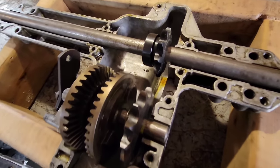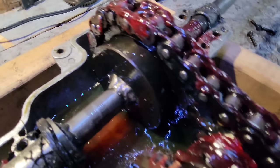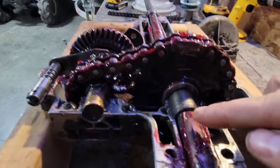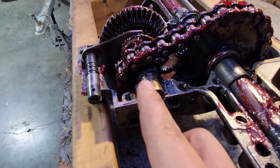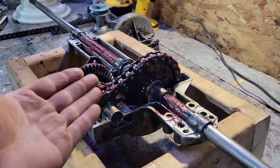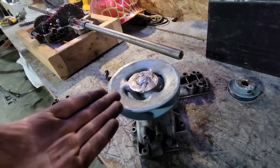Everything is completed. I welded some lock collars so the shaft won't slide out of the transaxle. I also welded both sprockets — I removed the 13-tooth sprocket and put the 10-tooth sprocket on the shaft. Now we have a 21-tooth sprocket and a 10-tooth sprocket. To make the 3/4 shaft sprocket fit on the 5/8 shaft, I put a 5/8 sleeve in that 3/4 sprocket and welded the crap out of it. This gear ratio works like a charm, and now we can swap our 2-inch pulley for a 5-inch pulley — which is now welded on the input shaft.